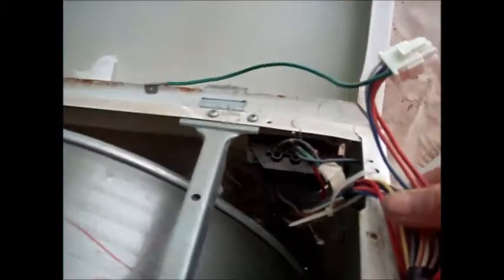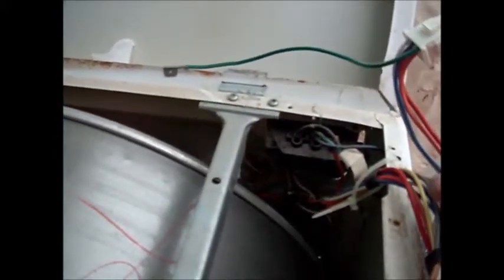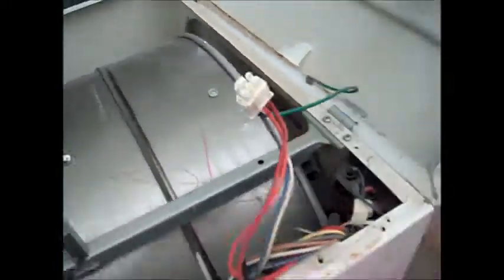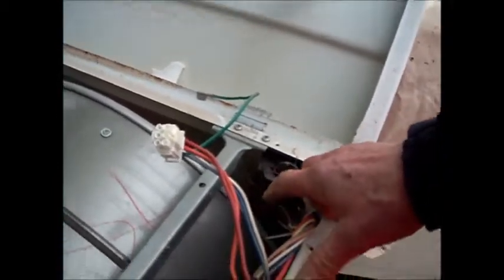It's very easy to check with a meter, and of course always unplug your unit before working on it. We'll get the meter and check that — that's probably going to be the problem. We're also going to take it apart and clean out and lube the moving parts. What particularly goes dry — usually starting with a squeaking — is this main bearing here inside.